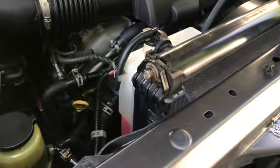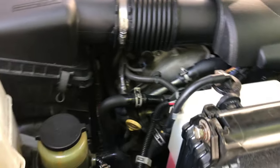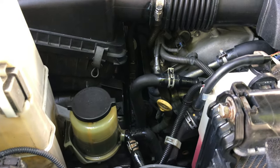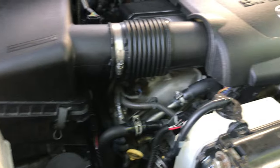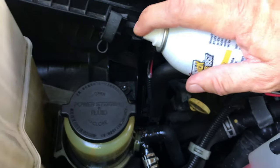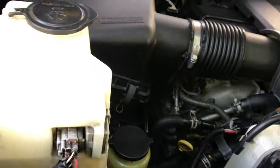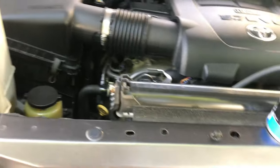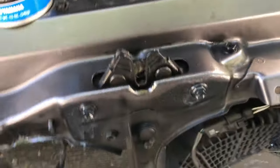All I do is — some of these things I zapped already last night — it gives them a nice coating because you may want to take some of these bolts off in the future. On the skid plate on this Toyota Sequoia, it's a 2012, I'm starting to get some surface rust on components underneath. The mechanic broke off two bolts I can't get out. So with only three bolts left, I'm more motivated than ever to zap everything — fam, even some of these clamps — just give them a little zap to coat them and keep them from rusting. It keeps oxygen off them and therefore prevents rust. Every little thing I can think of, OCD mode — a lot less labor intensive than trying to get a broken bolt off.